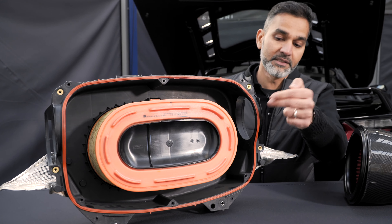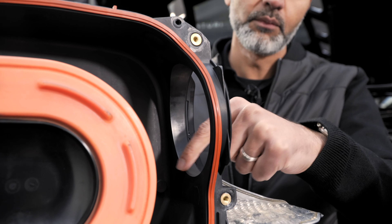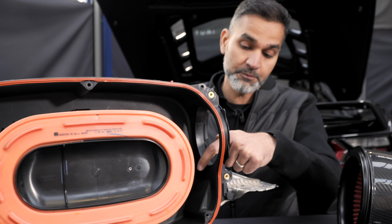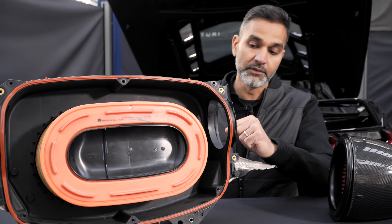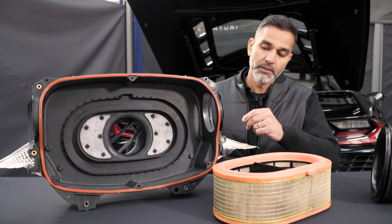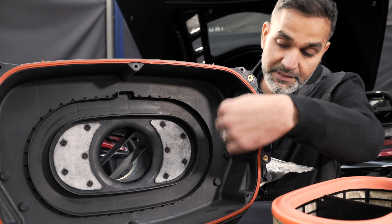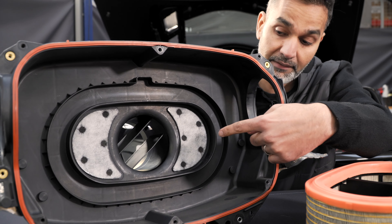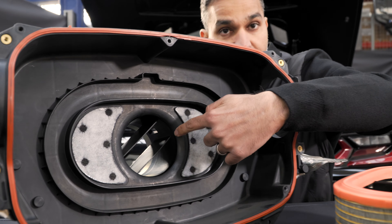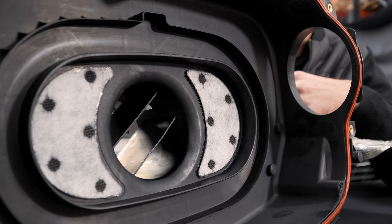As I mentioned in the previous video, if you look on the inside of this airbox, there's a very sharp edge right there with a 90-degree drop. That means that as the airflow comes into this airbox, you can have flow detachment around this sharp edge, which isn't good for laminar flow and it adds drag to the whole system. With the filter removed, you can see the path that the airflow has to move through to get to the MAF tube. The filter is in this area and it has to basically negotiate a 90-degree bend immediately into that MAF tube area. There is a small velocity stack right there, but it's not massive in terms of its size, and there will be turbulence issues.